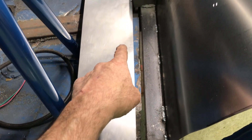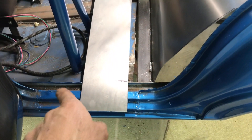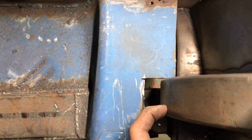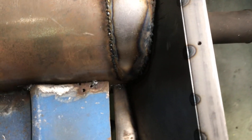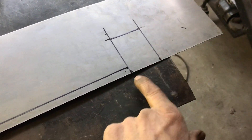Alright, so I'm going to make these two panels here to meet this marked-out line. Bring it back over here, cut a slot in it, then cut this end off, then weld all that clean so it's got something to weld to, and we'll attach it all the way around. Putting this piece in here — I'm going to notch it for the rail. This side is deeper than this side, so it's got to get notched accordingly. That's the rail — this comes in, this goes out.